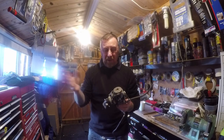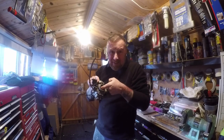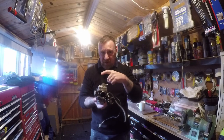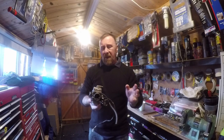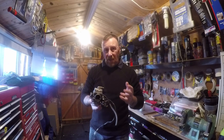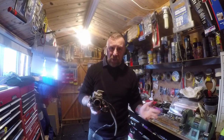If it's not working you need to get another one anyway rather than try and mess around — parts are hard to get. Still basically the same; slides in there. You can still get your carb cleaner in there. When it's upside down, take that off and you can spray all in there with your carb cleaner and get your jets out. Don't use anything else but carb cleaner. People have said you can use WD-40 — that's a no. It's an oil-based water repellent. And don't just dip it in petrol; it's sitting in petrol, it's not going to do much.